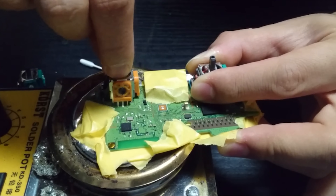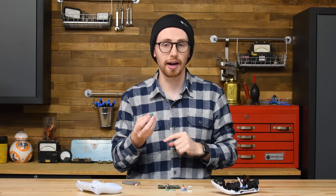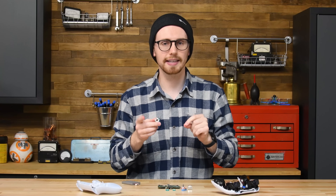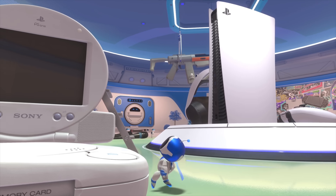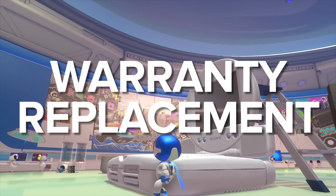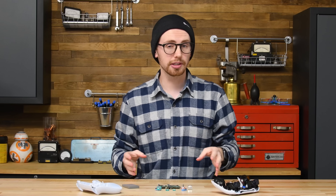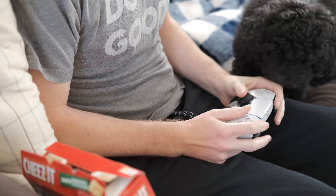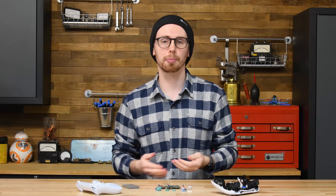We'll leave links for a bunch of these videos in the description. You can probably find the part and maybe even do the soldering, but the potentiometers in brand new joysticks from the factory often require advanced calibration, so even a brand new joystick can drift. If you're experiencing drift on any controller, you have three real options: fix it yourself or through an experienced tech, send it to the manufacturer if it's still under warranty, or buy a new one. After this research, it's bizarre to us that console makers don't consider joysticks to be consumable parts and design them to be easily replaced. No device rated for a finite number of actions, especially one that lives near so much contamination and takes so much abuse, can maintain perfect performance forever.